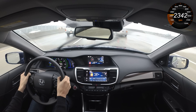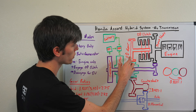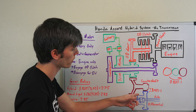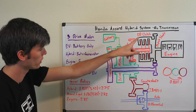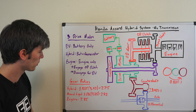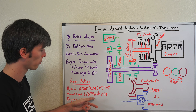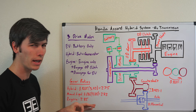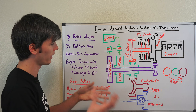One of the interesting things to look at is how this is all geared. From the overdrive gear to the counter shaft, we have a gear ratio of 0.805 to 1, and from the counter shaft to the differential we have a gear ratio of 3.421 to 1. Multiplying those across, our overall gear ratio for this system is 2.75. If you look at the manual Honda Accord six-speed, it has a sixth gear ratio of 0.686 with a final drive of 4.105, giving you 2.82. So this is a slightly taller gear ratio than the Honda Accord manual six-speed in sixth gear — somewhat equivalent to being in an Accord in sixth gear.